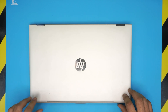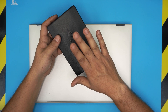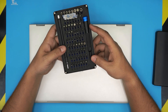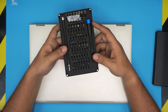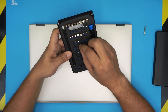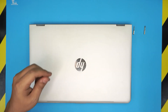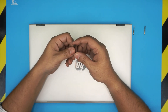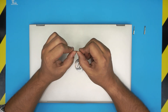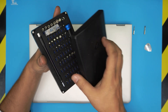First, the tools you're going to need: a screwdriver set. I recommend the iFixit toolset — the bits are made out of S2 classic steel, which means they're really tough and will last you a long time. You're going to be using a Phillips number one and a Torx number five. You'll also need a guitar pick or opening tool — something like this. A guitar pick is great because it has really soft edges and is tough to bend.